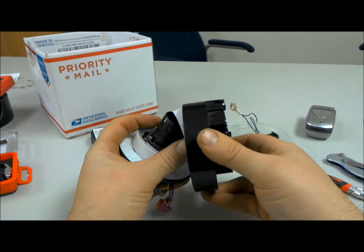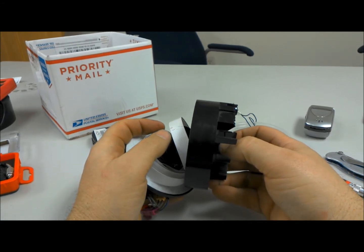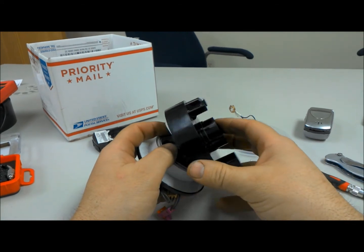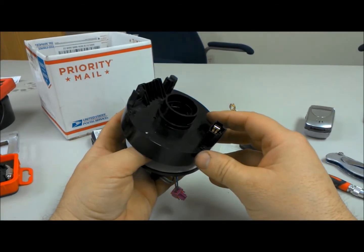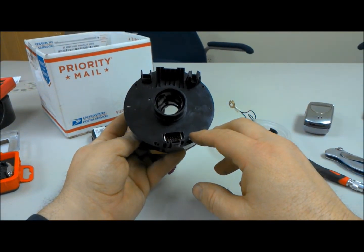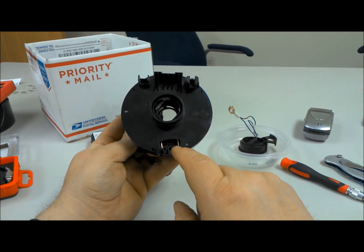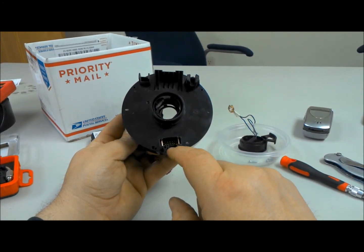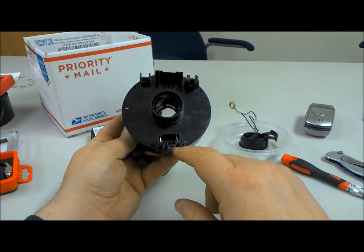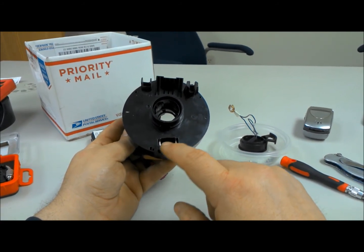As you hold this, I consider this wire one and that wire ten, and there's ten wires in there. The two outside wires — one and two and nine and ten — are for your dual stage airbag, and those are those pins there. I believe one and two are there, one on the bottom, then two and nine and ten by the way I numbered them, but I'll do diagrams of them. When you remove these connectors, there's a little metal tab there and there that grounds those pins out.